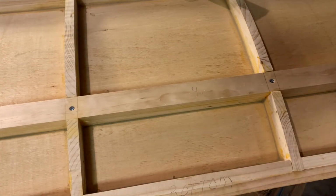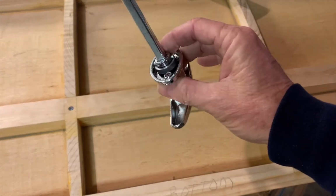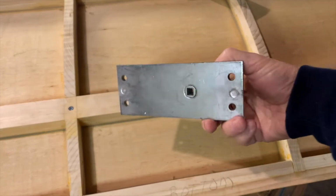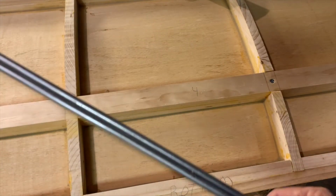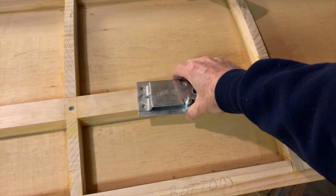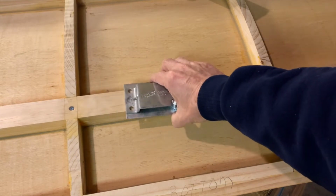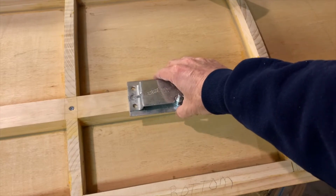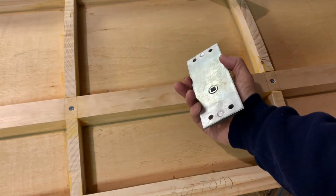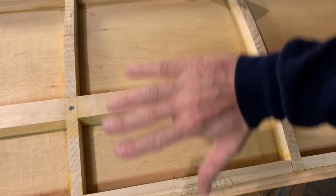Okay, before I skin the outside of my galley hatch, I need to drill a hole for a latch and a lock system that I've got here. This will go from the outside all the way through, and it'll connect to this piece that'll fit up under here, and it'll lock it into the sides by using the rods here. So what I've got to do is support this because from the inside this has to fit to mount in these holes here. So I've got to add some 1x2s here. I'll probably just add one on top and one on the bottom to make sure I have enough room for that support, and drill a hole so I know where the hole is whenever I skin this side from the inside. I can drill that hole back out to mount everything. So let's put that support in, drill that hole, get that done, and I can start skinning.